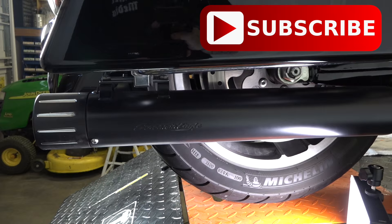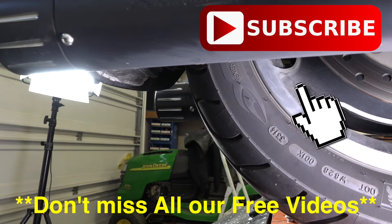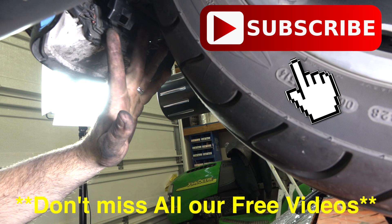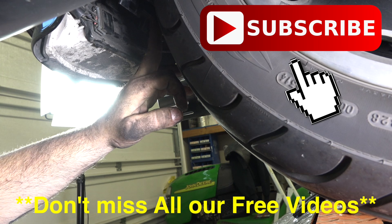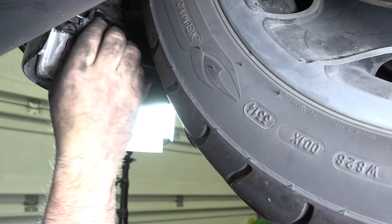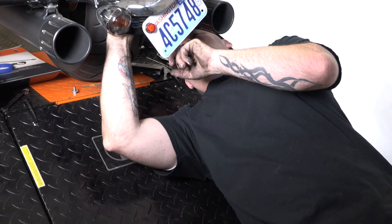Right side of the bike — just moving right up underneath. We're looking for the box where this plug goes in. That's the cover right there that kind of rocks back, and then he's going to point to where that plug plugs in right there. That's where you want to go ahead and back that plug out. He's got a screwdriver and he's working on both of those tabs on the side. He popped it loose — both of those tabs with the screwdriver — and there's the stock plug that we need out. Good to go.